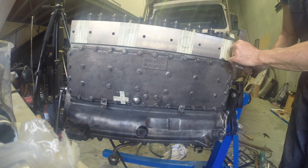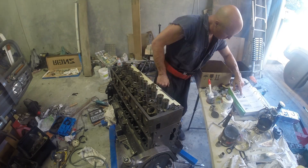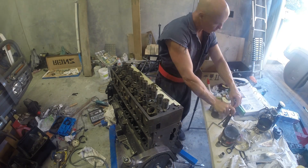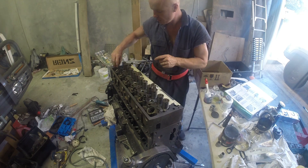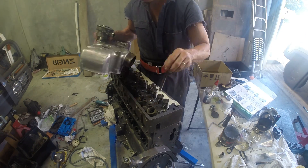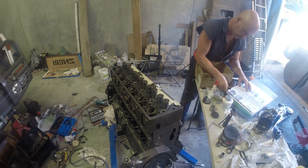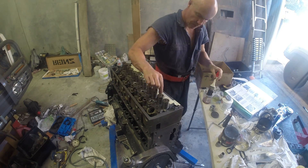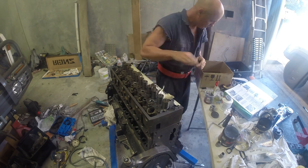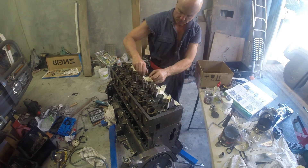And now the cylinder head is down. Next was to fit all the cylinder head bolts. There are some special bolts - these bolts are where the intake manifold and rocker cover line up, so you've got to make sure you fit those in the right places. I'm using a little bit of oil on each of the bolts, because that's what the book says.